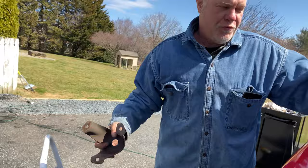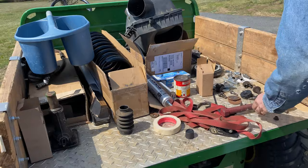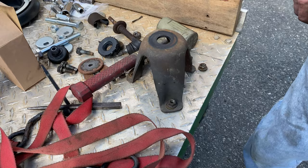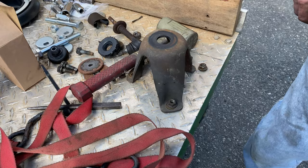The shock's pushing up on this as I go - makes it a little bit more difficult, but not the end of the world. We're going to go take the bottom off in a second. I wanted to get warmed up, so I started up top. I already had the top off while you were looking at something else. There's the three bolts - we're going to want to put those back. They go with the shock tower.